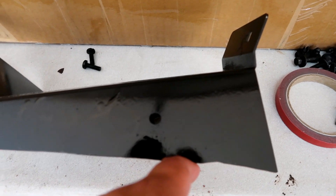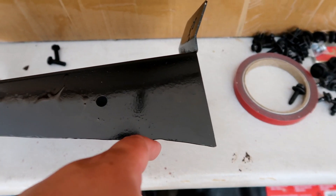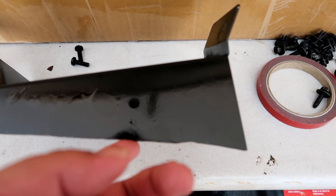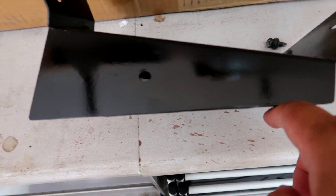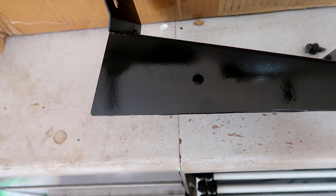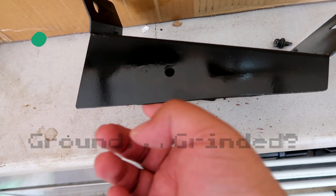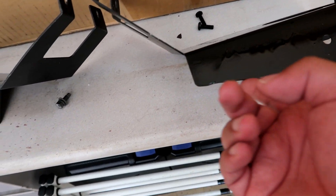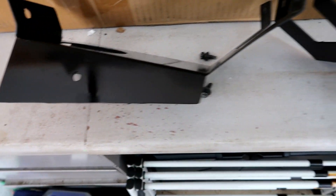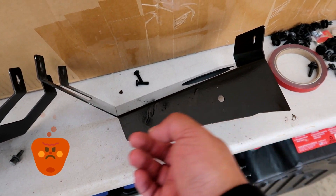But here are the fruits of my labor. Here's the first bracket I modified — as you can tell it's not a straight line because I thought I could just remove specific areas, which didn't work out. I ended up having to cut about a quarter inch off the whole thing just so I could fit everything without contacting the oil cooler. Here is the other bracket — the edge cut was a lot cleaner because I found out I just had to remove a quarter inch off the whole bracket. After the cutting for both brackets, I grinded the sides to make sure it's smooth, then used some gloss black paint I had lying around to cover the exposed metal so I don't have to worry about rusting. I think it came out well, though my OCD is really bothering me — maybe I'll get a new set of brackets to make the cut even.